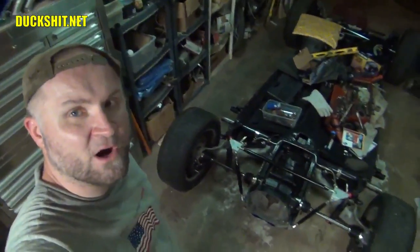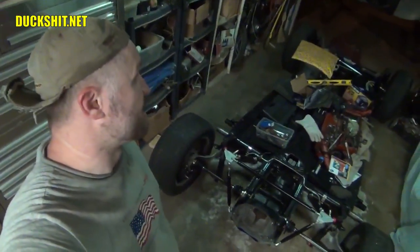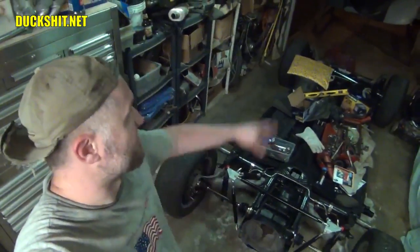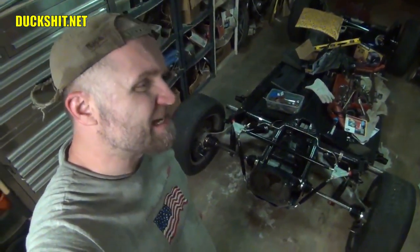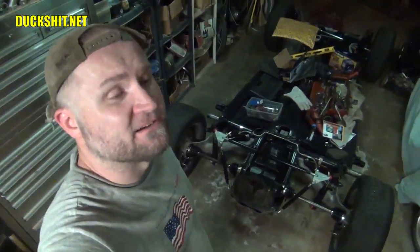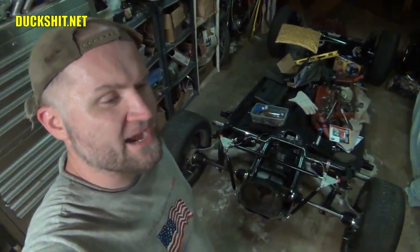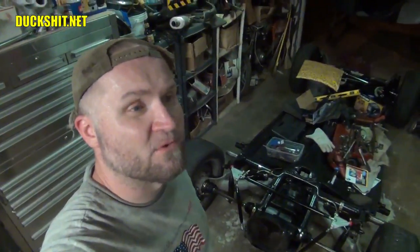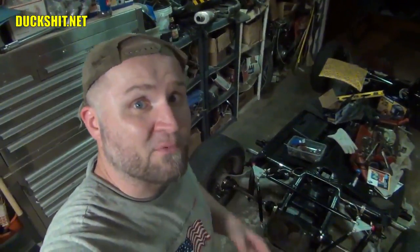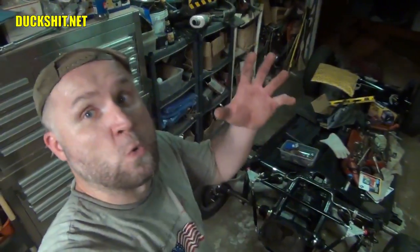I'm going to try to get one up tomorrow where we put the engine in. I'm going to get started on that bright and early, as soon as I get up and out of bed, hopefully if nothing's going on. I got a nice shady spot in here because the sun shines in the driveway at about that hour. And I believe I'm probably going to be lucky on that, and the engine's going to run, because I put them underneath the workbench a couple years ago, and I know they were running when I put them away, and I packed all the intake and exhaust ports with a paper towel to keep all the dust and dirt out of them. So I think I'm just going to put them in there, change some oil in them, crank the engine, and make sure that it builds up oil pressure, and then make sure we got a spark, dump some gas in it, and see what happens. Oh, I think it's going to run.